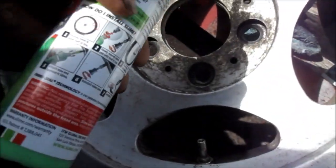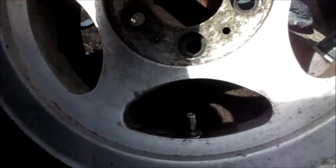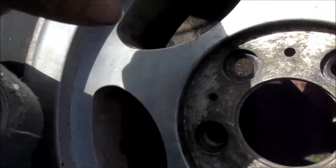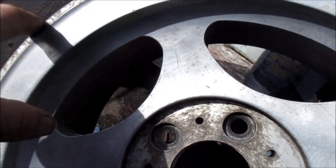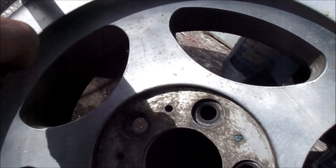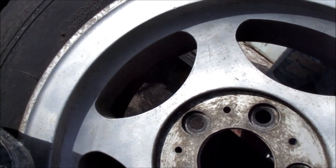I've already done this one — I had about a third left in the can and I poured a third in here. The way I put it in is: remove the core, let all the air out, then take your goop and put it in there, put your valve core back in, and then fully inflate it. This is supposed to be 35 PSI. I only put 25 PSI in this one because my 12-volt inflator petered out at about 25 pounds. It's always a good idea to max the pressure out — if it says 35 pounds, put 35 pounds in.